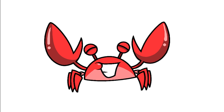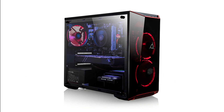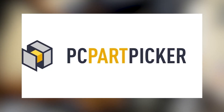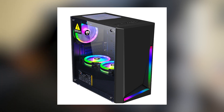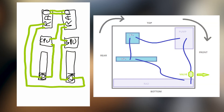Now let's go into some tips before starting your PC build, whether it be water-cooled, air-cooled, AIO-cooled, whatever. The two biggest tips I have before even buying anything are: make a blueprint for your build, and prepare for the worst. By blueprint, I mean make a parts list, make sure they are compatible with one another using PC Part Picker, and make a rough draft of what you envision your PC looking like. For example, if you planned on building a mini ITX PC, you need to make sure all the parts fit in your case, especially if you're doing a custom water cooling loop, as radiators can take up a lot of space. Also if you plan on doing custom water cooling, make sure to draft a couple ideas on how you want to loop all the parts together.